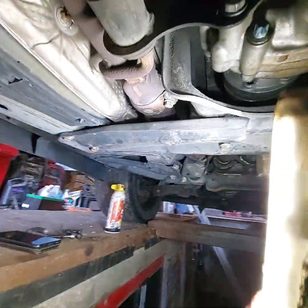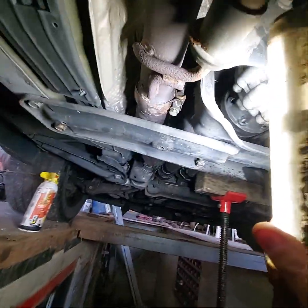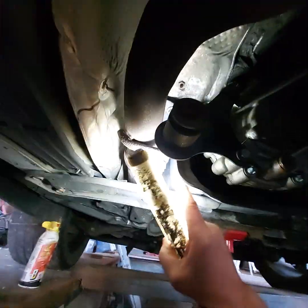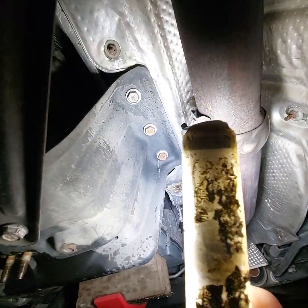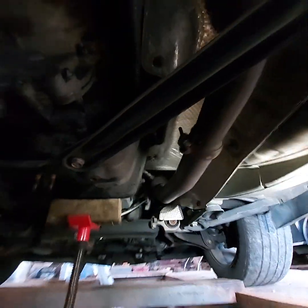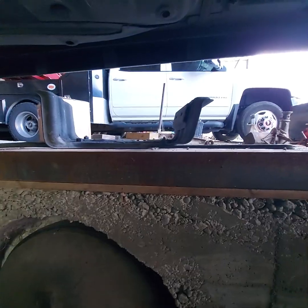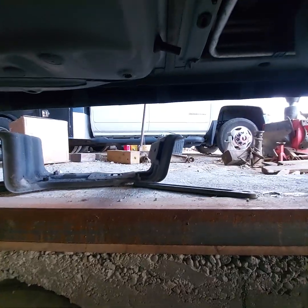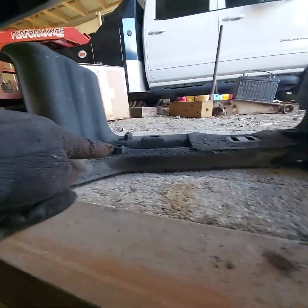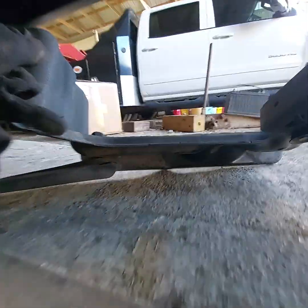Wow. Anyway, this bracket right here, it's got 3 16mm bolts up in there. We're going to have to get them, and on the passenger side, 3 more up there. So let's get them out and take that down. So I took that down as an assembly. Just left all that stuff bolted on. I have to find a new bolt to put in there.